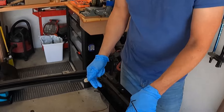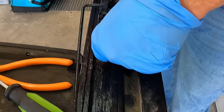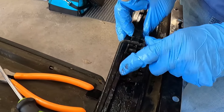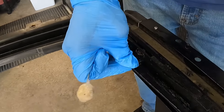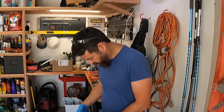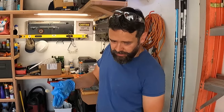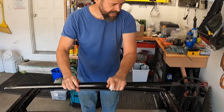For this side I'm going to put more grease in the channel and slide this in to lock it into place. A little tip: if you press this all the way down, that piece will actually pop up out of the groove. You need it all the way down — just line up that edge with that opening. There's a slot right there. Then slide this in. Now the most important part: whatever you do here, you just match the other side. Pick a spot and go 'I like it all the way forward at this adjustment spot,' and make sure you do that on the other side. Then we flip it over, put the back piece on, then the rivets, then the motor, and then put it back together. Then we've got to do the calibration.